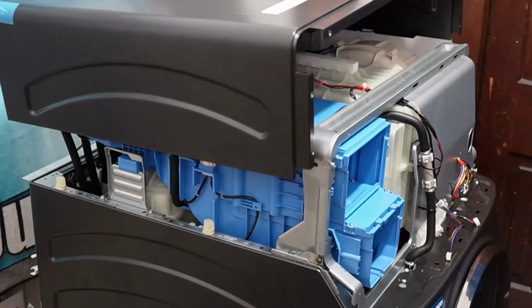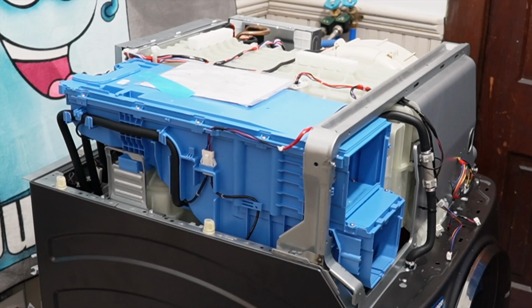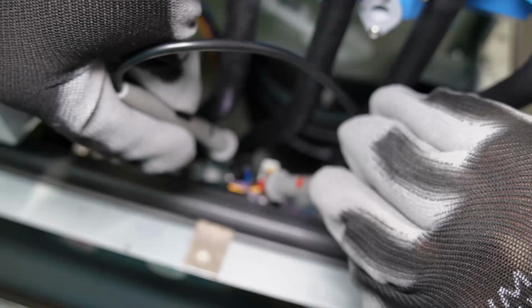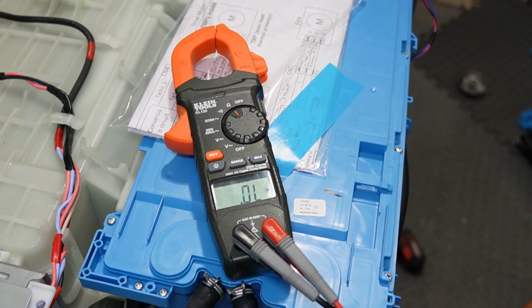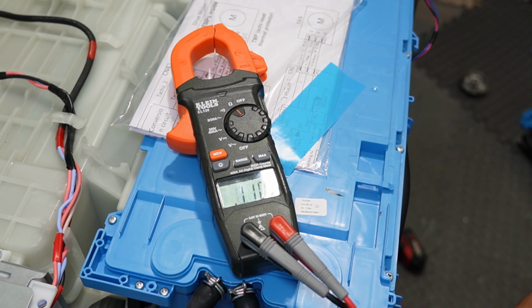This will expose the dispenser, main control board, and blower inverter motor assembly, as well as the heat shield assembly on the very front. At the rear of the unit, in the right corner, you're going to have the whole water valve system. You can now test these valves with a multimeter to see if they are bad electronically. Set your multimeter to ohms resistance, then tap the connectors onto the top of the wire harnesses. When the leads are pressed to the metal connectors on the harnesses, you should get between 1,000 and 1,100 ohms of resistance on each of the 5 connectors.